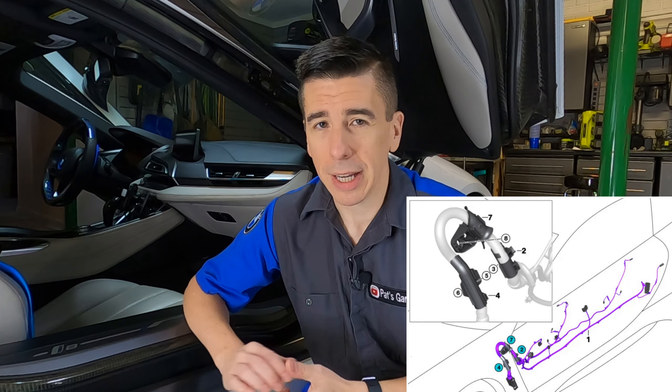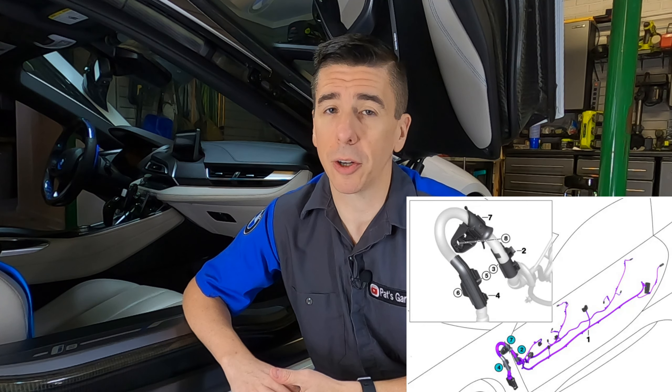If you have an i8 and yours has cracked, there's not much you can do. You could put a little electrical tape around it, but the tolerance between the two plastic parts that ride inside the fender is pretty close, so it'll probably end up tearing the tape off of any broken sections. The wiring harness is about $200, and it's probably going to cost the equivalent to have a mechanic replace it. You could take this to almost any independent mechanic with European motors experience and they'll be able to take care of it. But if you do try to DIY it, check the link in the description for the e-manual and promo code and you could follow the steps yourself.